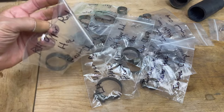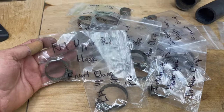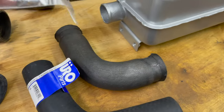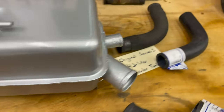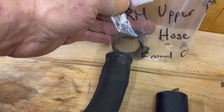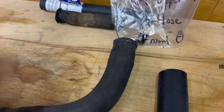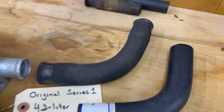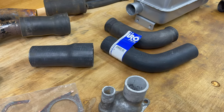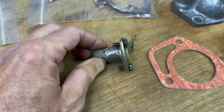These are all the hose clamps from this car - every one is bagged so they'll all go back in the exact same place. For example, this is the right-hand upper radiator hose front clamp - this clamp went right here, and you can see by the mark on the hose exactly where it was and what direction it faced. I also have a million pictures so they'll all go back in the same spot in the same orientation.